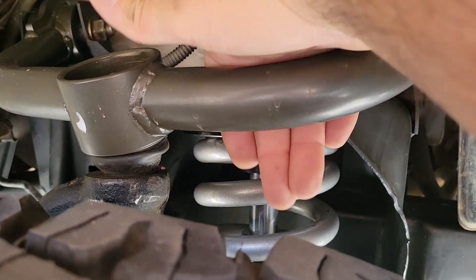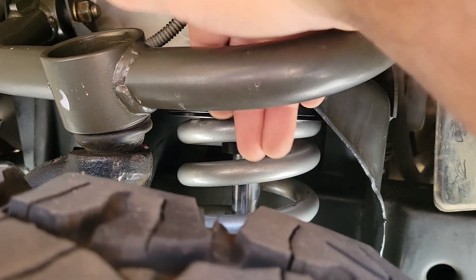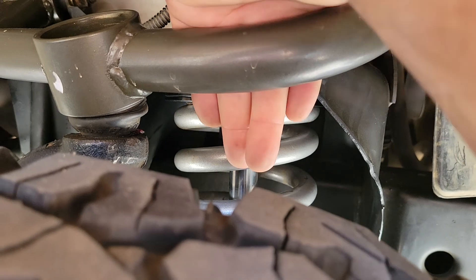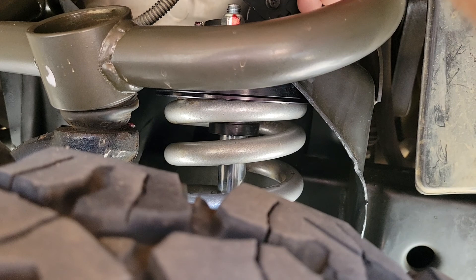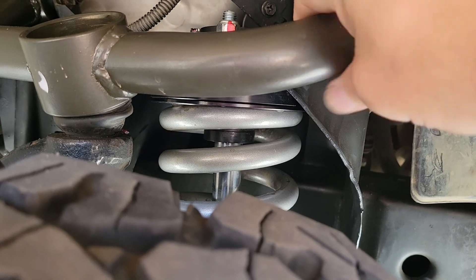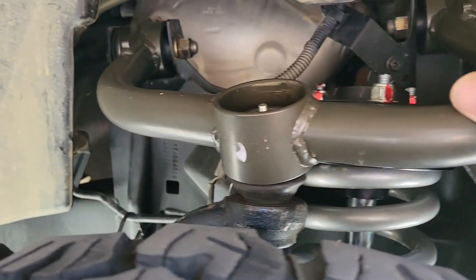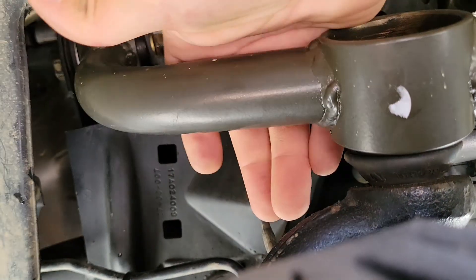What I like the most about the All Dog Off-Road upper control arms is there is literally no coil bucket contact. I'm putting my hand right now between the upper control arm and the coil bucket — no contact whatsoever. That's going to give you more droop, more articulation, more flex, and you're not going to hit the coil bucket.